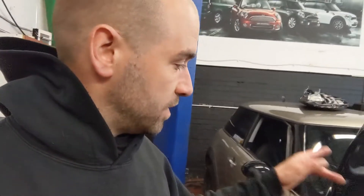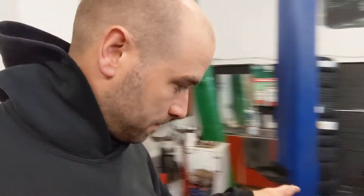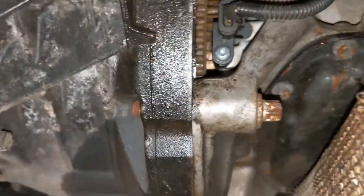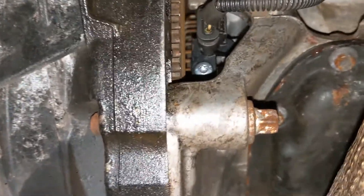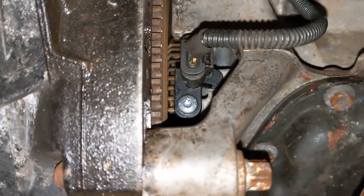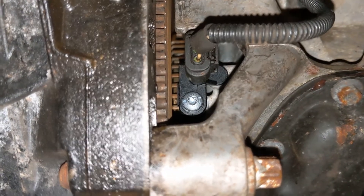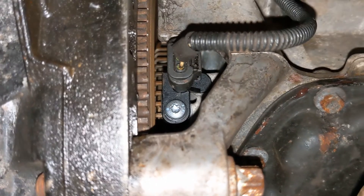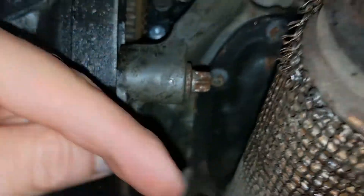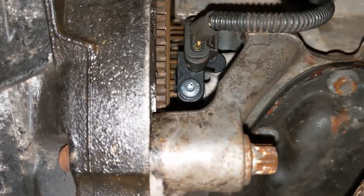Now, the fault has ended up being the pickup ring for the crank sensor. I'd just been under it checking the voltage to the crank sensor, and it just so happened that by chance, when you look past this ring here and past the crank sensor, you can see the pickup ring just in there. It has teeth on it, and it just so happened that where the engine had stopped, I saw one that was bent at about a 45-degree angle.